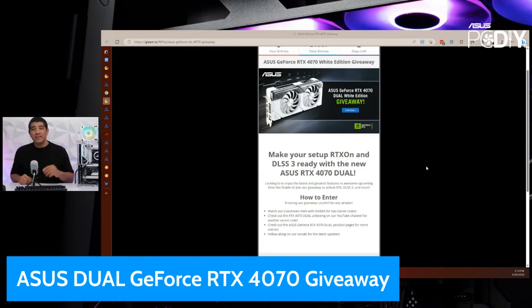And the other really cool thing is it's an extremely power-efficient part. So you're talking about generally under gaming workloads, you're under 190 watts. So that means if you've got something only maybe like a 650-watt, 550-watt power supply, you're fine. You don't need to upgrade the power supply. And it only uses a single 8-pin PCI Express connector. The dual card and the Tough Gaming cards actually both use legacy 8-pin PCI Express power connectors, as opposed to the newer 12-volt high-power connector, which will actually be on the ROG Strix card. And we'll talk about a little bit of the design differences in a little bit, in terms of how that can be maybe beneficial to some of you that are maybe more interested in performance tuning.